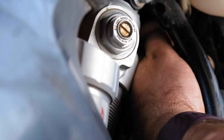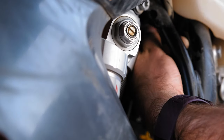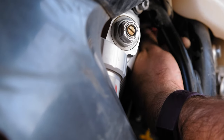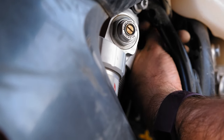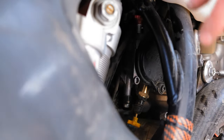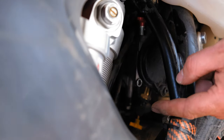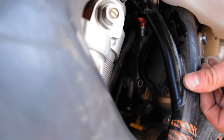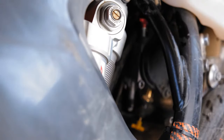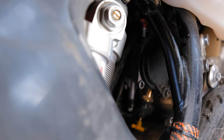It's really hard to get this red one adjusted because you can barely grab it. In my case it came from the dealer driven all the way in, and obviously that's not right, so I've got to figure out what the range looks like. The yellow screw I've backed all the way out — I'm going to have to try to adjust that when it cold starts. When you press that in, it opens the butterfly valve a little bit and lets extra air in to mix with the extra fuel the ECU is adding.